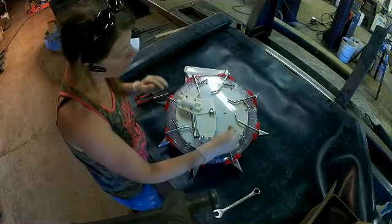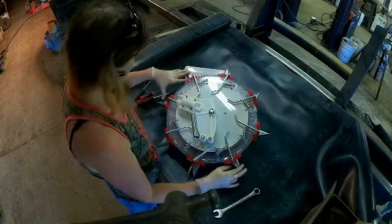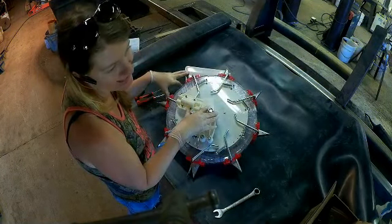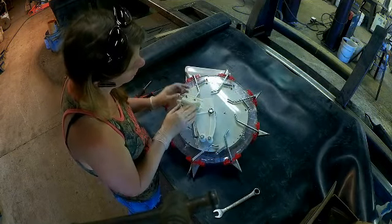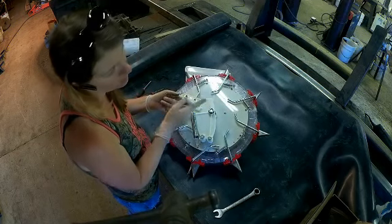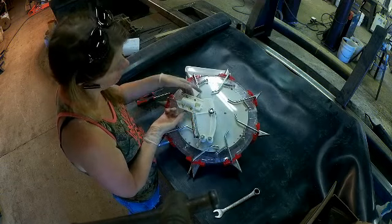Okay, I've already gone ahead and this is how we're gonna change this from an eight head into a 6 head. I've already removed the planting push part. It's real simple. It's 4 bolts here, 4 bolts on the other side. They have set-in nuts to keep them in place.